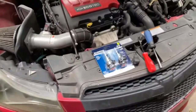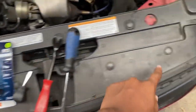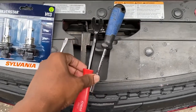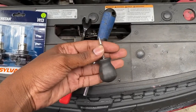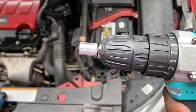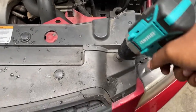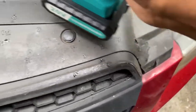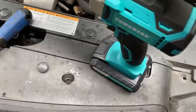Starting from the top section of the car, you're going to remove these bolts — bolt one and two — and also these tabs right here. I do have a tab remover, but you could use a flathead screwdriver; a longer one is preferred to get the job done. You'll need a 10mm socket or wrench to remove them.